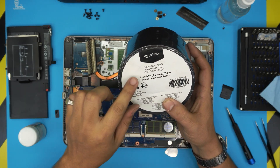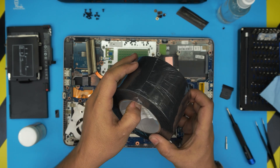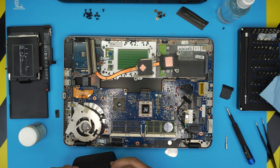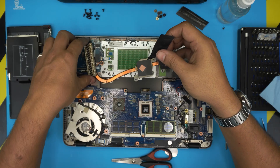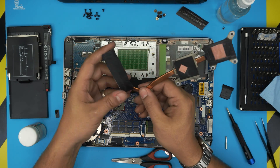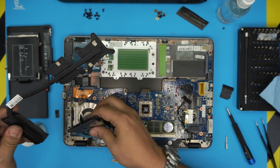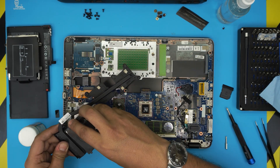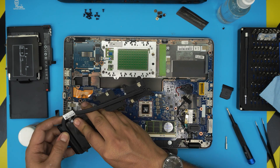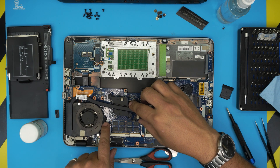You can use heat-resistant tape from Amazon Basics — it's a good first tape with real heat resistance. Let me open it up and cut a little bit so the air can travel directly through the heatsink without escaping from the end. Place it right there, then put the fan over so it actually sticks to it on the bottom. Now place the heatsink assembly on top — it's the same type of tape that was originally used.